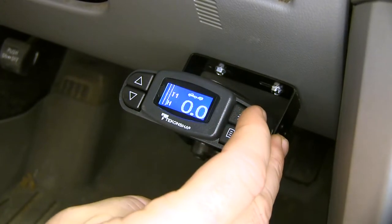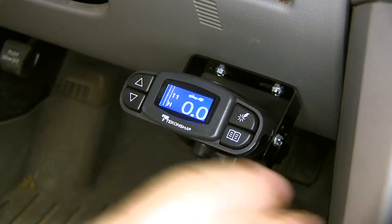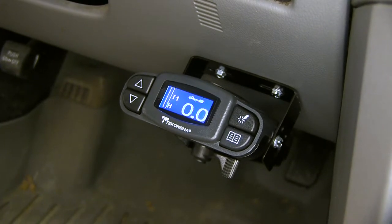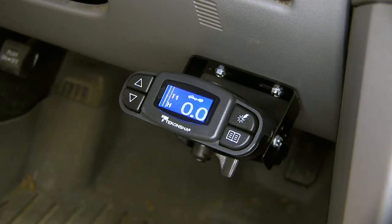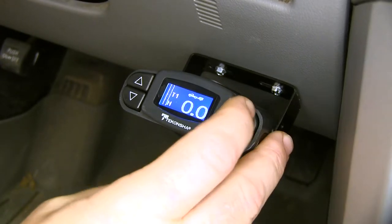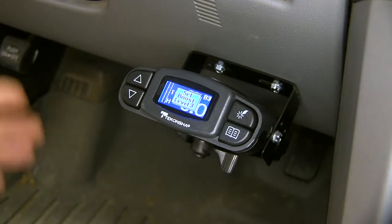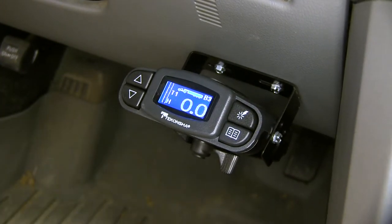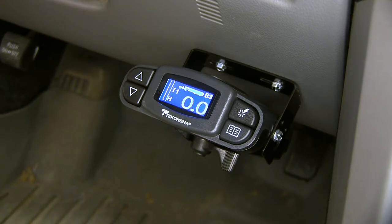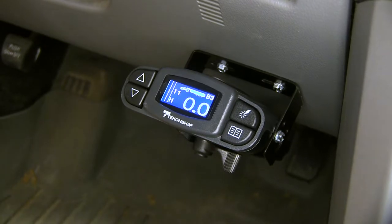This button is going to be for your boost. Your boost setting gives you three levels and an off setting. Boost off is for a lighter trailer, maybe a small trailer that's unloaded. The higher the trailer weight relative to the vehicle weight — for instance, if you have a trailer that weighs the same as the vehicle — you'll probably want boost two. When the trailer weight goes over the weight of the truck, you'll probably want boost three. The boost adjusts the aggressiveness of the braking force sent to the trailer brakes, saving the truck brakes from having to slow the trailer down.